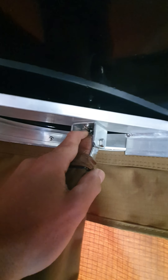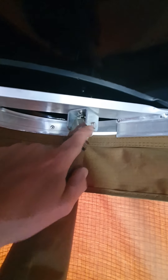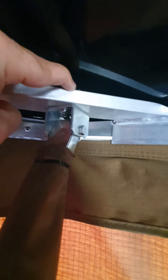My fix was to drill out the two rivets at the back because they'd already worn loose, and trying to push them back in would have been just a half job. So I removed the strut, undid the bolt, drilled out the two rivets at the back, and replaced them. I drilled right through this member here very carefully, because you don't want to push your drill bit right up through the roof. Then I went ahead and put nuts and bolts right through there.